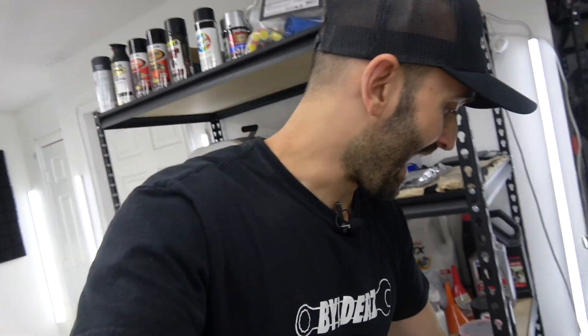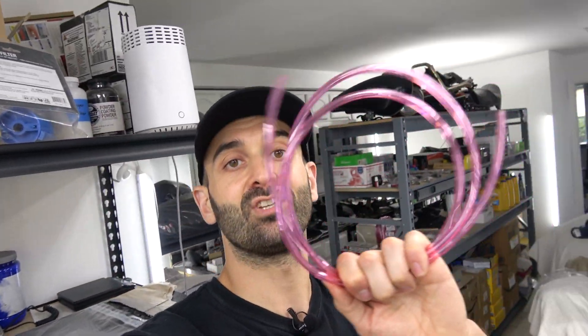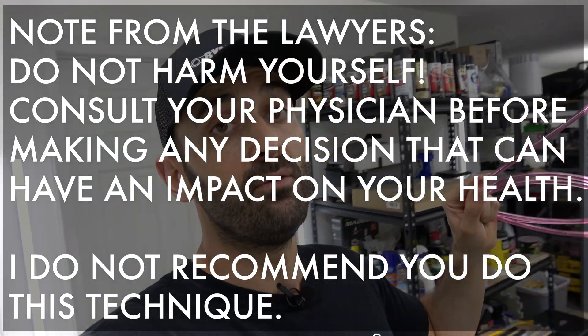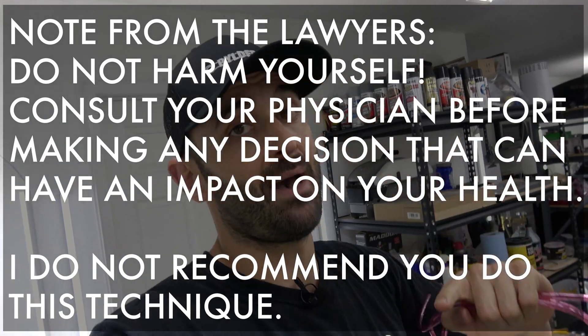Excellent! So we have about 6% leak in the engine, which is really good, but we're going to try to see exactly where the leak is located. The regular option is to use a mechanic stethoscope — I don't own one. What I use instead are breather hoses from my carburetors. It's the perfect diameter to go in my ear. I'm going to use my best ear — we all have one — plug one side in my ear and go around the engine with the other. Be very careful: if you have a big leak with a lot of air flowing, you don't want to damage your ear.